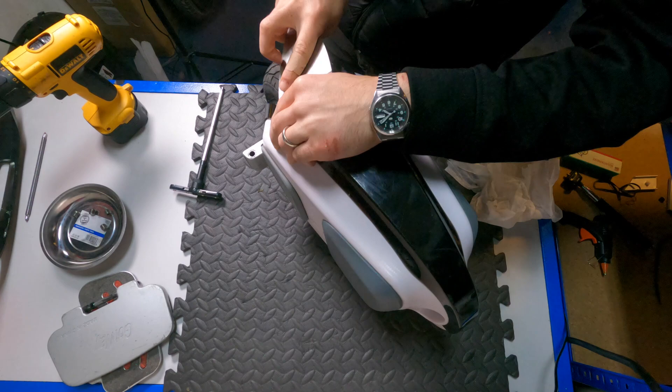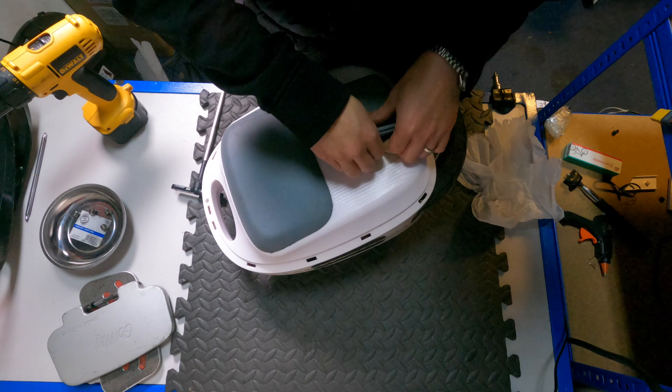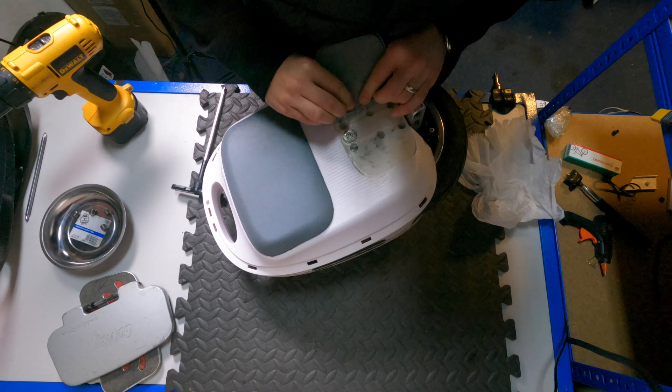then we can get onto the front and back panel of the M10-3. The panels are held by plastic clips, so we need to be careful when we remove them, because we don't want to snap the clips. After we have removed the plastic covers, then we need to peel off the ankle padding, because underneath we can see six screws that are holding the motor to the chassis.